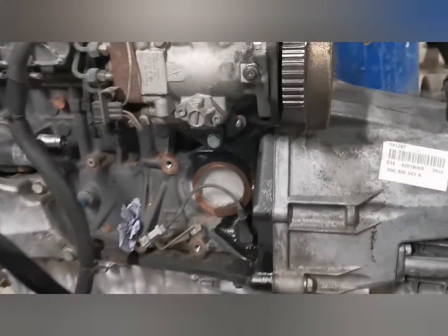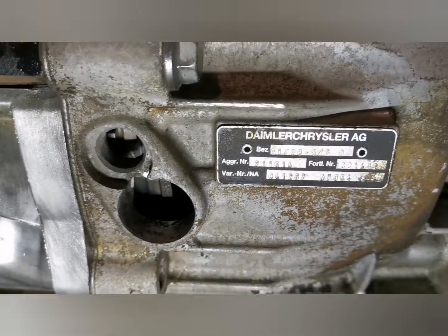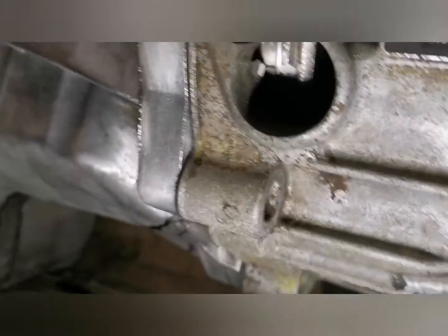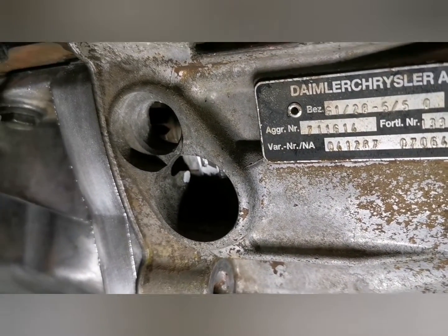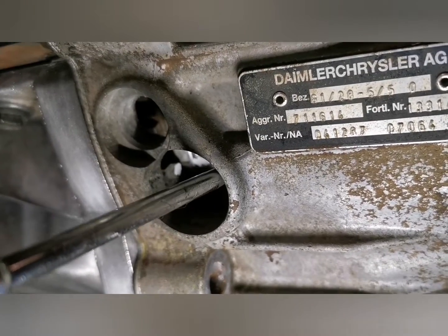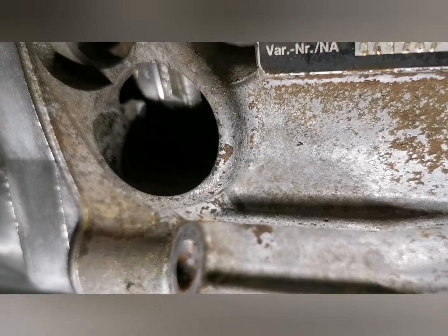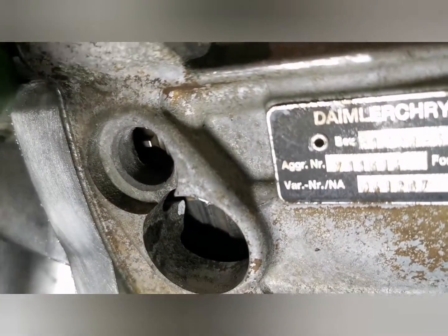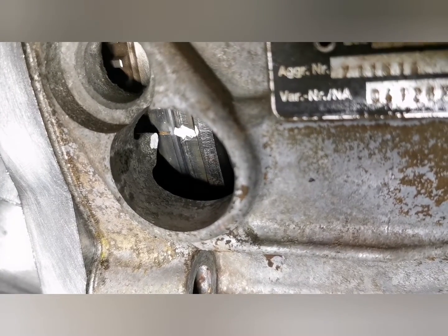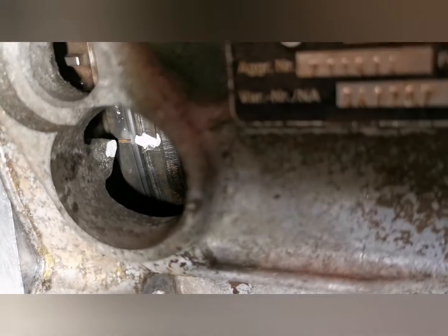The first thing you want to do is set the engine to TDC. When it's in your van you want to be underneath, where you've got this plaque with two holes. Inside you'll see there's an arrow casting in the gearbox — that's the one you want to be looking at on the engine side. Get someone to rotate it and you'll see the point. I've put Tip-X on the flywheel as well — that nice cut line on the flywheel is your TDC marker.